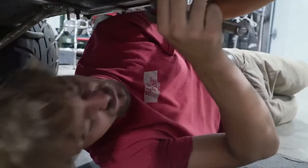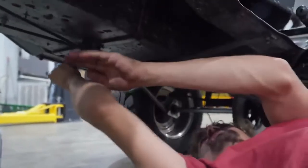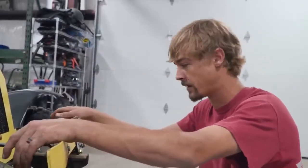Because look, this one's already bent from a really epic parade. There's no telling what happened on that day — unless it's been the 4th of July. They jogged this thing. But yeah, we're going to reinforce this because I can twist it just by hand. I'll show you the articulation that this front end has — it's got a pivot bolt up front, that's why I called it like a half-link. The rubber bushing is completely gone, so we're probably going to repair that with a piece of radiator hose. These lower links are what we're replacing — they're so tiny, and already bent. We think it's the original front suspension. There's supposed to be a transverse leaf spring across here, and there is a leaf spring, but that piece of steel is thicker than the whole frame stacked together, so there's no way it would ever actually bounce. But it's cool that they mimicked the original Model T front end as close as they could.